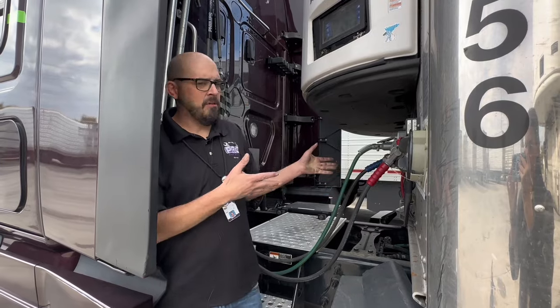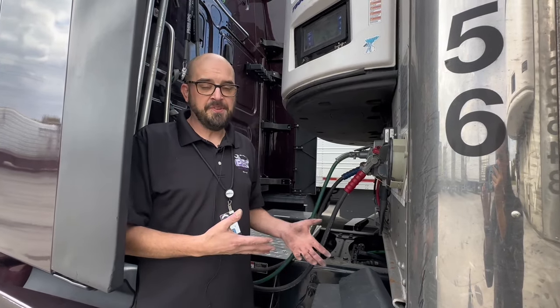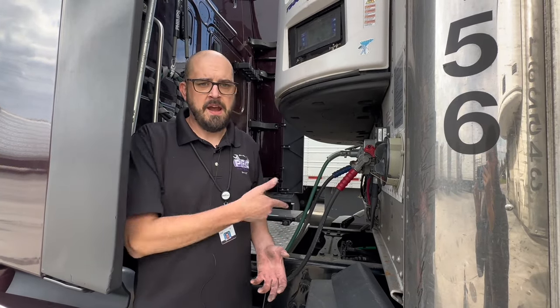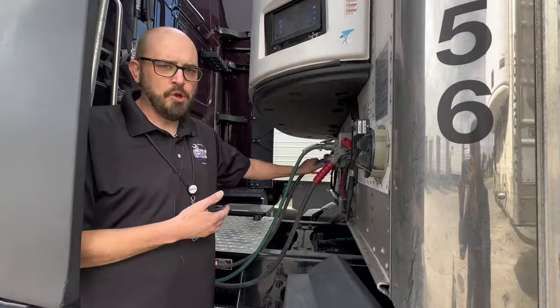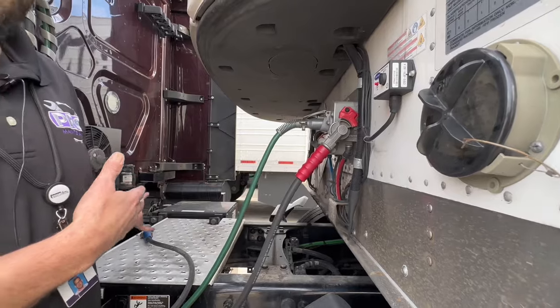Here are the airlines on the back of the cab. When you need to move your tandems and those parking brakes are not holding the trailer still, simple solution — you don't need any chocks. If you have chocks on your truck, it's a waste of space. All you got to do is get behind the cab of your tractor right here and take this blue airline off and throw it on the catwalk. You don't need that blue airline.